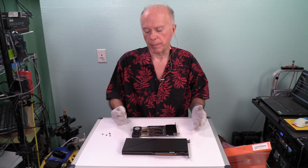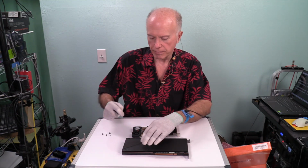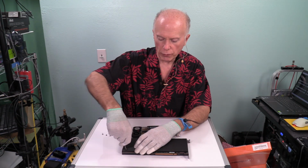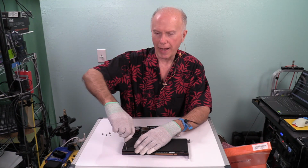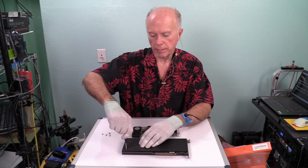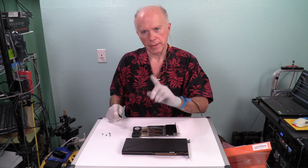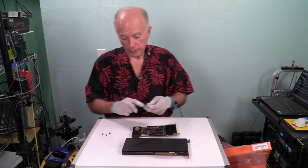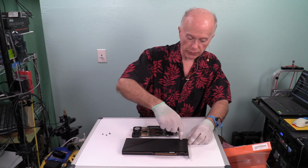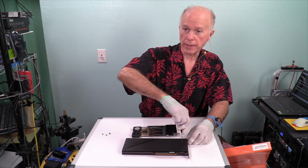But to do that, I've got to put the video card in an 8-lane slot, which I don't have a problem with doing, but I haven't done it yet. And then the next question: have you tried 4 of these cards in a machine? No, I have not yet. But to do that requires a WRX80 because I would have to have 4 16-lane slots electrically, not just mechanically. A lot of people don't realize that just because you've got a 16-lane slot mechanically, we have to look at the resources and see how that's laid out.